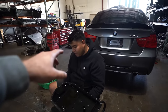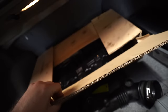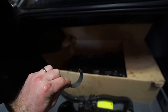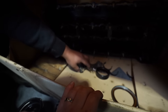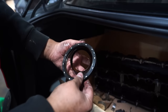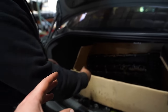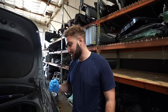We need to talk about what we found in the trunk. The previous owner actually replaced the rod bearings — these look to be the old rod bearings that were originally on the car. So it's possible this engine has had extensive work done on it. N54s don't have a lot of rod bearing issues, but they also found the front main seal and rear main seal have been replaced. So everything's been replaced on this car — this is a solid N54, recently done. This is the kind of person who doesn't only do modifications but actually does all the proper maintenance.